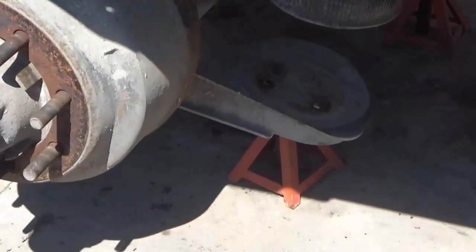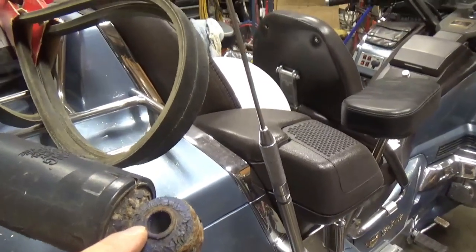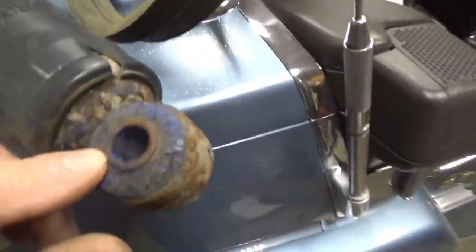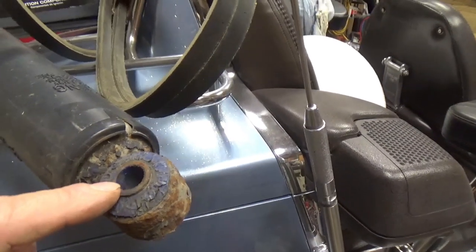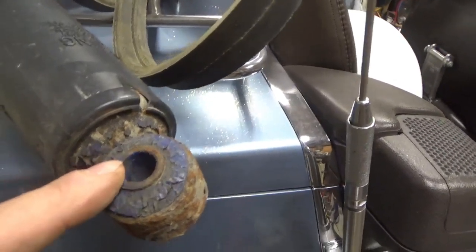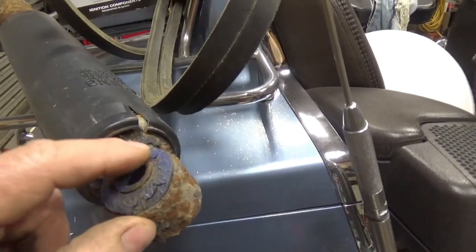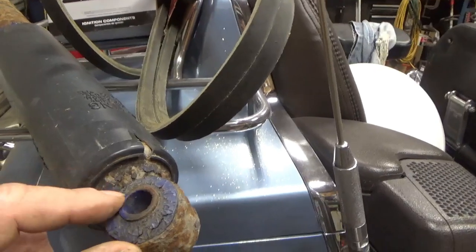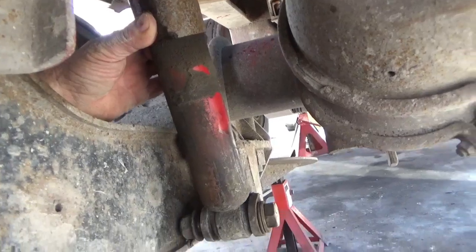This shock came off a pickup truck. Someone asked why I can't use an induction heater on the shock bolts. I could use it on the nut on the outside, and I can heat that with a torch or apply more power. What's not going to come off is the steel sleeve inside the rubber bushing on the shocks — that sleeve is rusted onto the bolt and completely seized, might as well be welded on. That's why these have to be cut off.